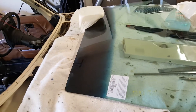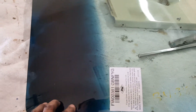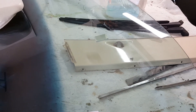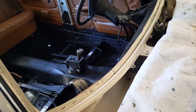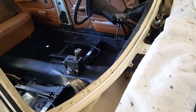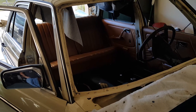That leads to the next major obstacle: the windows. I did buy a new windshield — my old one cracked when I tried to tap it out. This new one is aftermarket with tinting, which I actually wanted. My concern is fitment, since forums say aftermarket windshields don't fit quite right, but we'll cross that bridge when we come to it. I do have new seals. I butchered the old trim, so I had to buy used trim from a private party — it's at the polishers right now. Once I get it back, I can put the windshield in, tighten the back of the headliner, and put the back window in. With the headliner complete and windows in, reassembly should go very quickly.